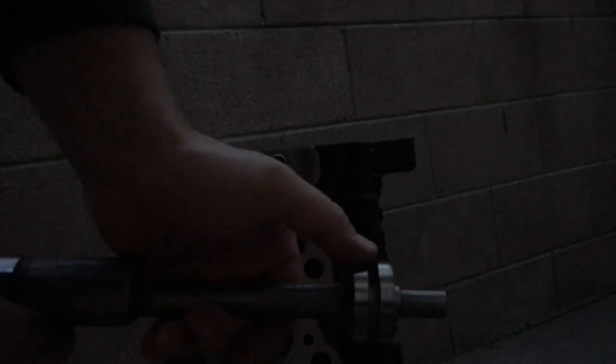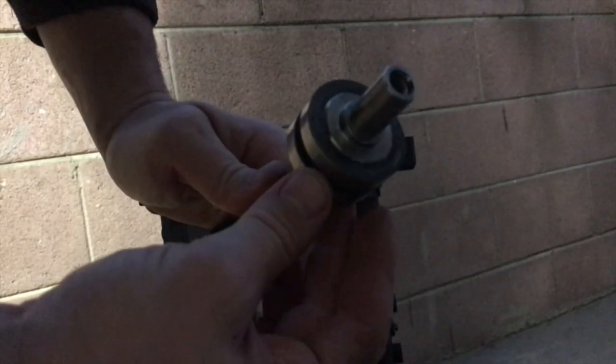Or if you're using a 32mm socket like this one, like I did, I managed to remove the first one and then you drop it in and you can knock the second bearing a little lower so it starts moving. You can put some WD-40 on it and then finish it — it took me like a couple seconds with the shift. Otherwise I would have had to guess what to use, but since both of them are out, this one is still in perfect condition.